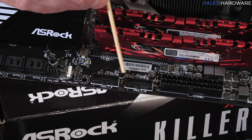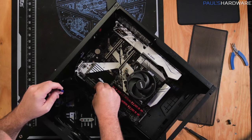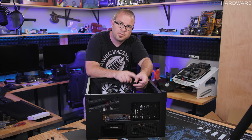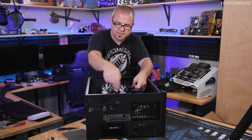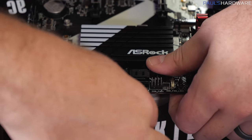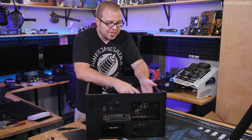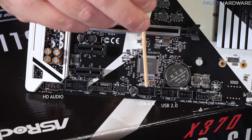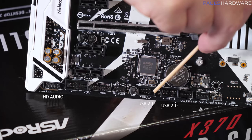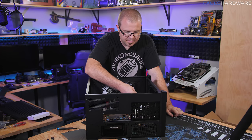There's a USB 3.0 plug from the case — this motherboard has two headers for it, so it doesn't matter which one we use. There are also two fan plugs from the two front case fans; these are four-pin plugs (fans can be three or four pin) — plug them into chassis fan headers on the motherboard. Next, two SATA data plugs from the SSD and the 3.5-inch mechanical drive connect to any of the six available SATA ports on the motherboard. Then there's the HD audio plug, which is the same physical size as a USB 2.0 plug — note the blank pin is in a different position, so they shouldn't get mixed up.